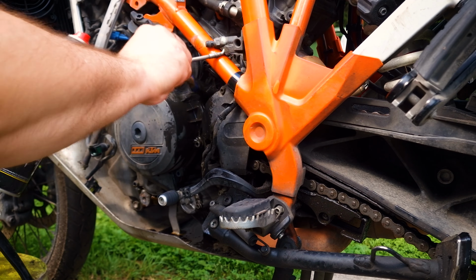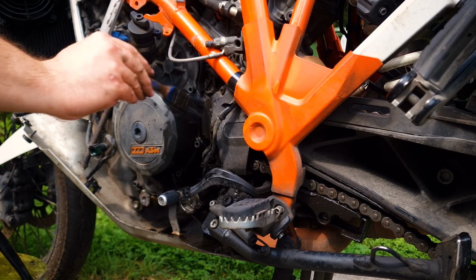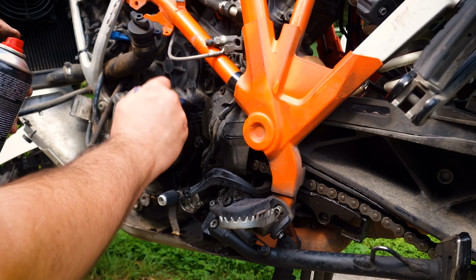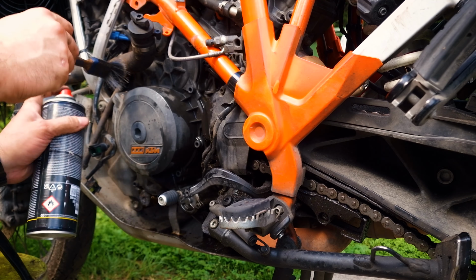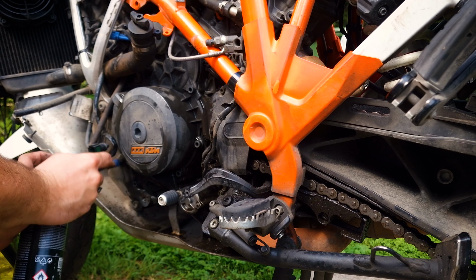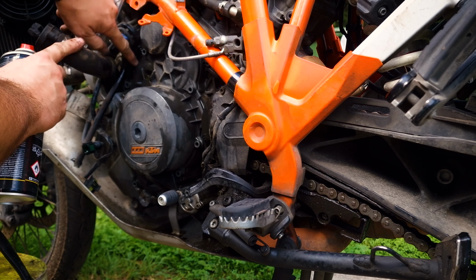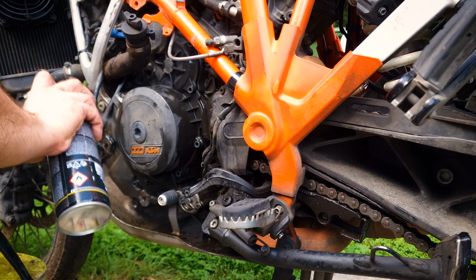Well, of course, clean everything at once, because it is not good if any dirt gets inside the engine. Spend some amount of time on a sufficiently high quality cleaning of the entire space around. By the way, a lot of people use brake cleaner, but I found a more interesting thing called industrial cleaner. It vaporizes a little slower and cleans the dirt a little better. You can brush on the cleaning compound for a longer period of time.